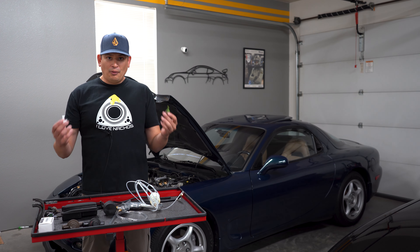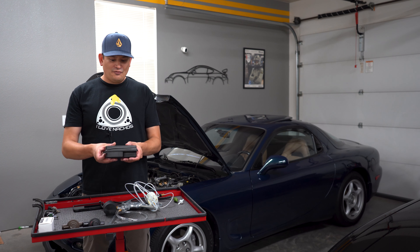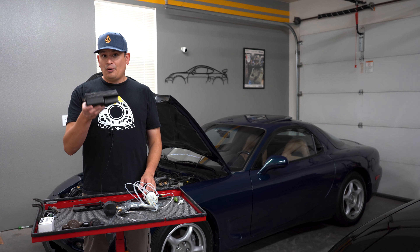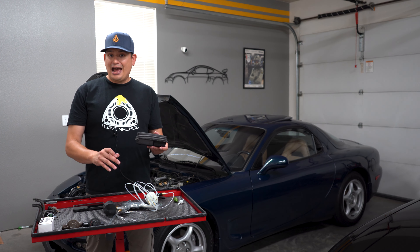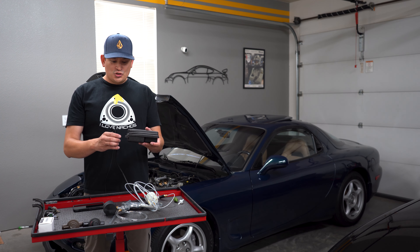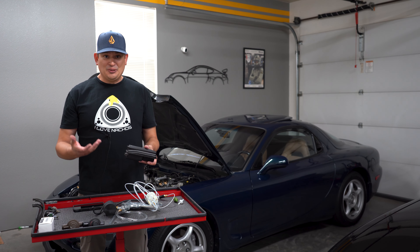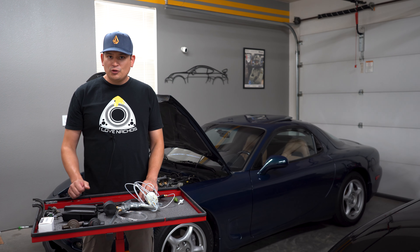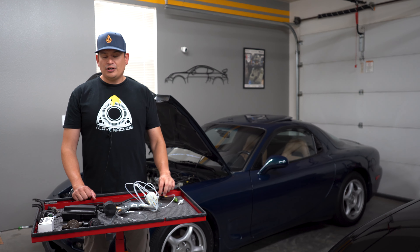When I first got my car I had an aftermarket check valve that had come apart — I thought that was my issue but it wasn't. You also have a vacuum tank and a pressure tank; the pressure tank is part of the secondary turbo system and can sometimes crack or fail to hold air. An easy check: after you run the car and drive it, pull off a hose — if there's pressure released, it's holding pressure. These are things you can check without removing much.